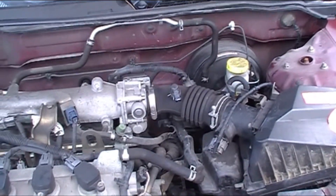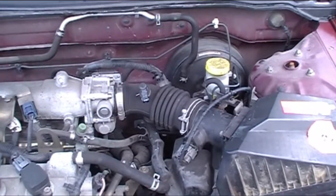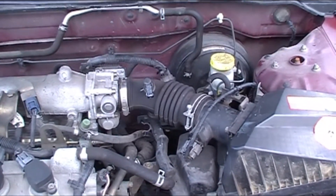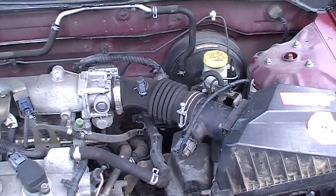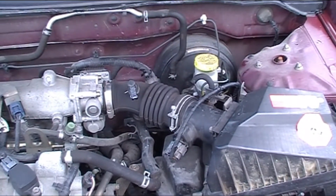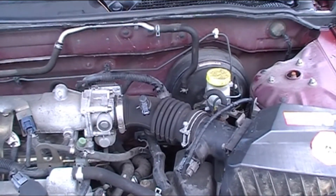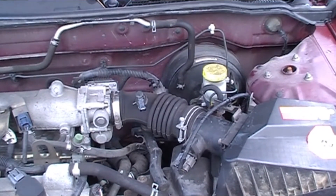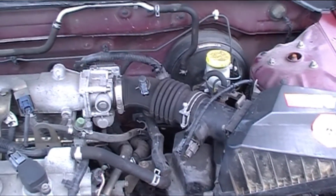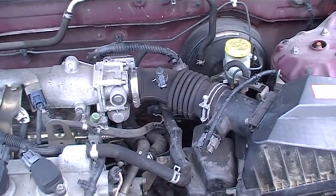What we got here is a 2005 Nissan Sentra. The problem is while driving it's cutting off, or when you come to a stop it cuts off. Sometimes it's hard to restart — it only happens once the engine is warmed up. I've done the simplest stuff like checking the fuel pump and PCV valve, anything that could lead to a fuel problem, and everything seems fine. After doing some research, it leads me to believe it's the throttle body — maybe it's dirty or maybe it's going bad because it's one of these electronic throttle bodies.